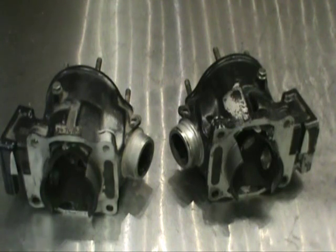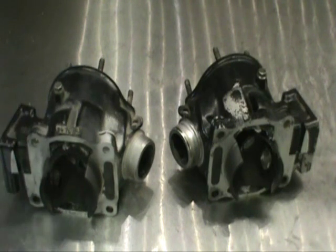Okay, here's the twins. First thing we're going to do — I actually have this whole engine in here. I might just take you right through the whole thing. I'm going to try to condense most of it so it's not 25 parts long. But first thing you're going to do is glass bead the cylinders. So if you get your hands on a sandblaster, glass bead, whatever — it's a good idea. Just makes it a lot easier to see the lines in there. So let's get these things sandblasted.